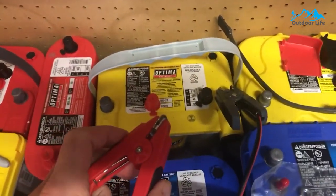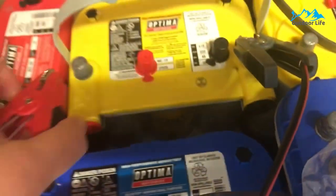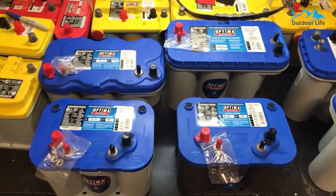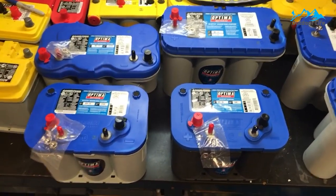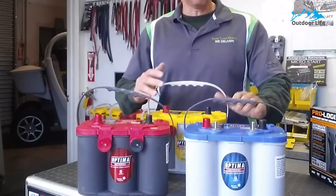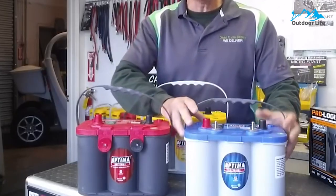This battery is designed for recreational vehicles or boats with large accessory loads. The Optima AGM marine battery meets all of these criteria and more. Both as a starter and deep cycle battery, it's versatile and powerful enough for a day of fishing. This model has a blue top and a light gray body, indicating that it's a multi-purpose battery. It's compatible with trolling motors that use deep cycle batteries and is rated at 55-amp hours, with a 120-minute reserve capacity ensuring consistent performance. It has a cold-cranking-amp rating of 750 when used as the starting battery.